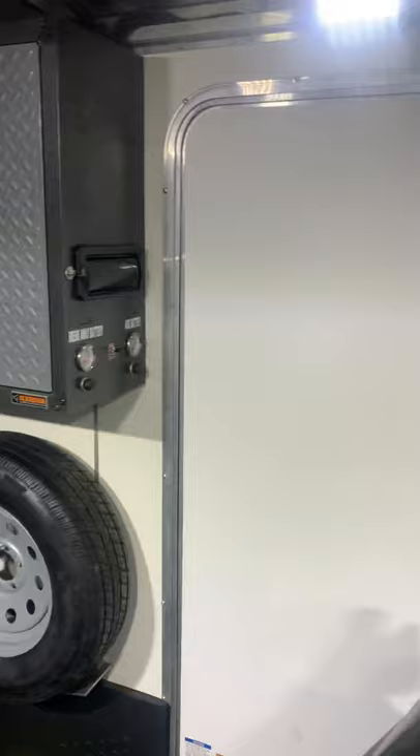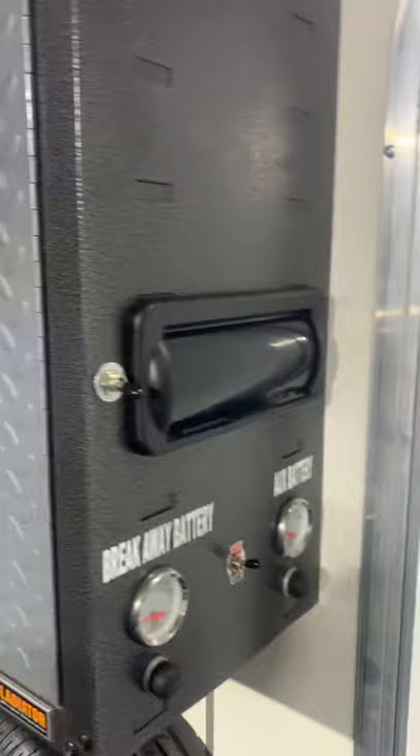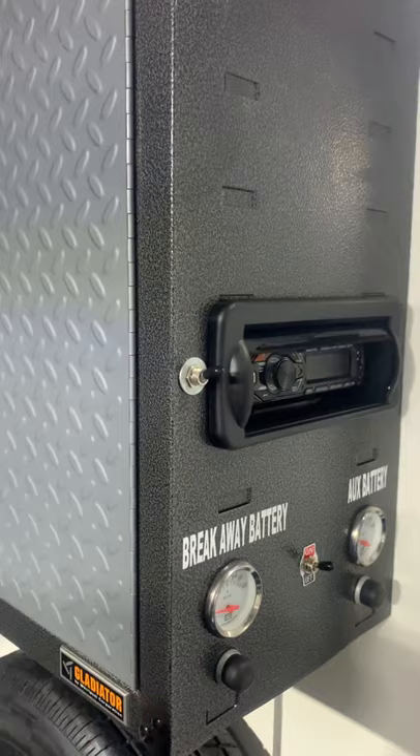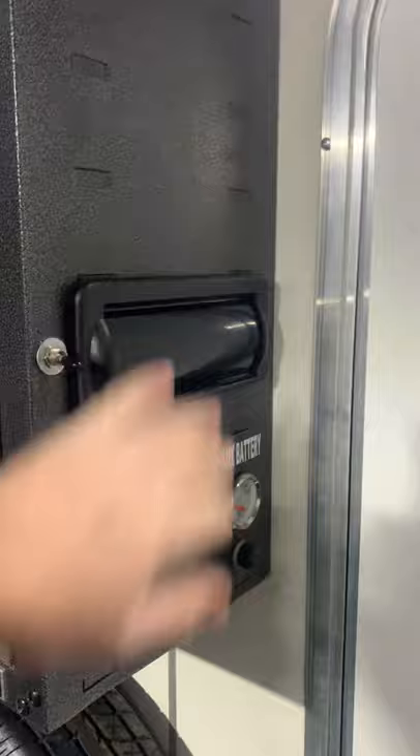As an added bonus this year, we wanted an AM/FM radio on this trailer. Couldn't find any way to mount one, so we ended up using a marine mount on the side of the battery on the toolbox we already had. This thing's awesome — it's hidden, it's up there. Same idea as everything else: I didn't want phantom watts or power draw, so we put it on a switch so I can turn it off when it's not drawing power, put the cover down, and I'm done.